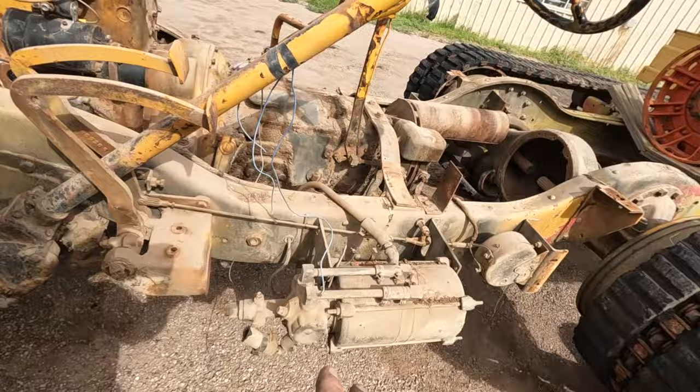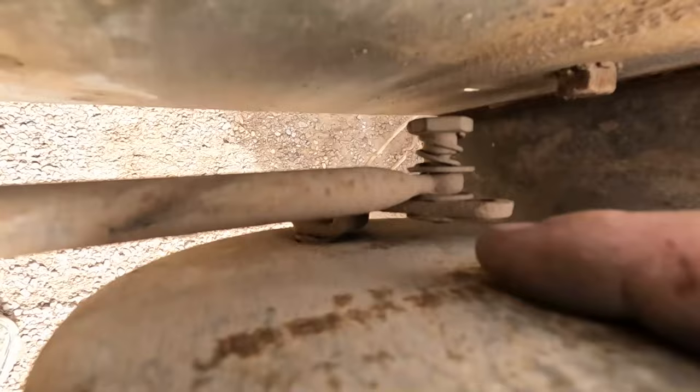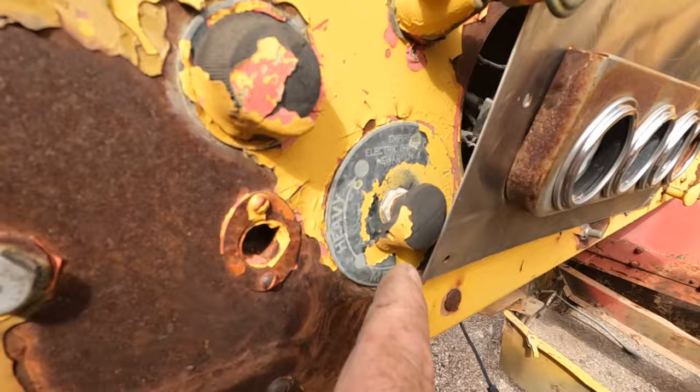It's going to be a lot easier to take out that hydrovac right now. And this is an interesting thing. This is actually a trailer brake controller. There's a rod going to the brake pedal, controls a variable resistor with the output here. On the dashboard here, it actually has a thing for Empire electric brake. This is whatever gave you the, well, I guess heavy, medium, what kind of percentage braking you want.